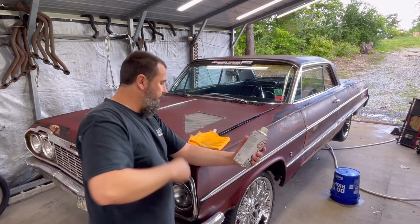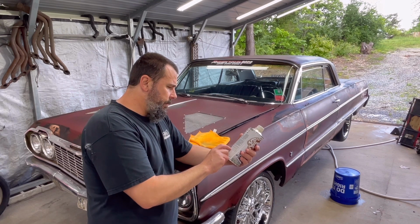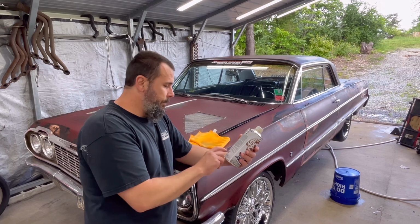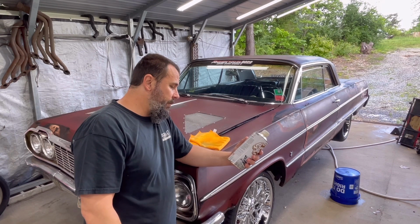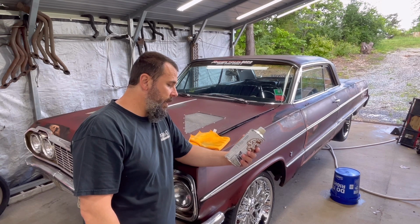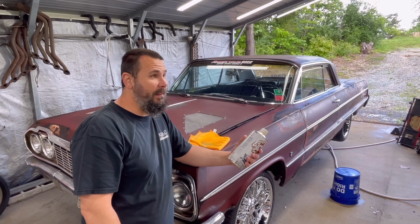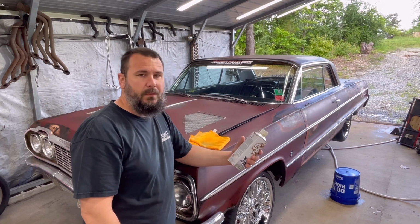This towel is clean from the side you can see, not so much the other. Apply sauce to clean microfiber towel or application pad and wipe on surface. Allow cure time 15-20 minutes. Use a new, clean microfiber towel, I have one of those, to wipe off patina sauce to achieve a desired matte finish. Repeat steps 4 and 6 to reach desired finish. Use happy ending detail wipe to enhance and maintain luster between patina sauce applications. I don't have that. Product can be removed with degreaser if needed. I don't have that either, but I'm planning on taking it off right now, so that's where we're at.